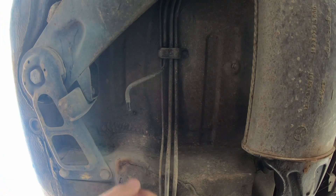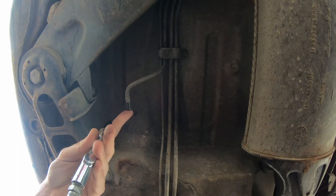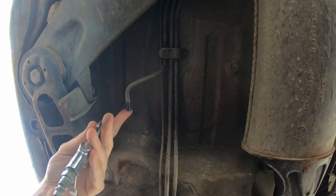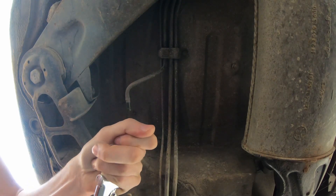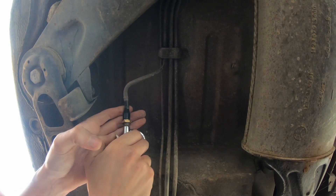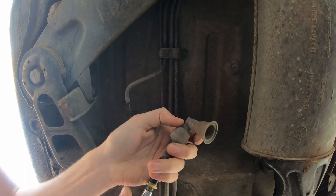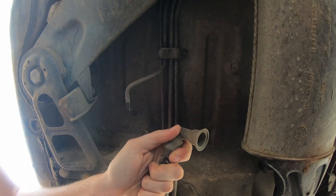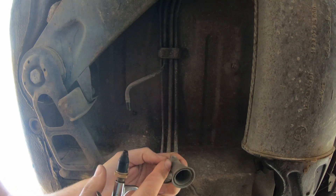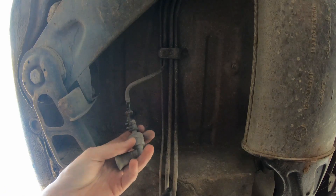That's a problem because when the tank vent is clogged, the tank collapses. So I'm going to use the same air hose that I just used to inflate our tank, put a little air through here and make sure our tank vent and tank vent line are clear into the tank. As a note, I have the fuel cap off for this. I can hear it - okay, so that is clear, but this end of the valve is not - it's clogged. So let's take this into the shop, clean it out, and then reinstall it.